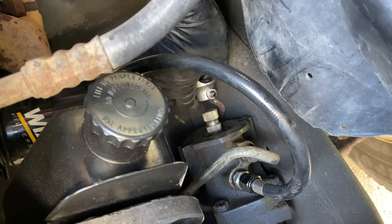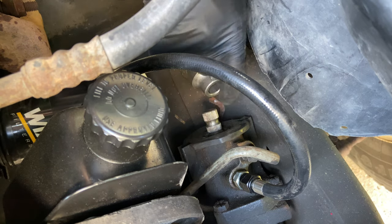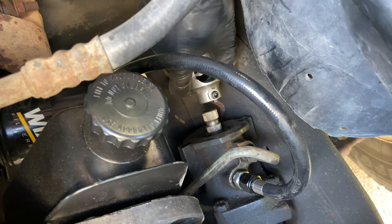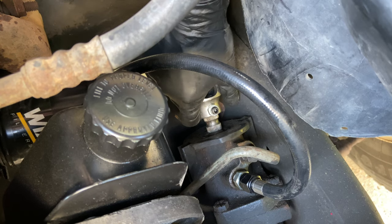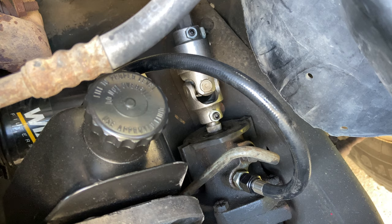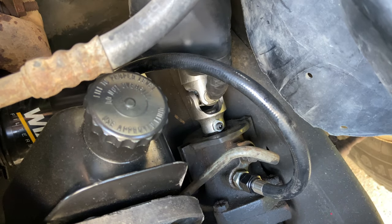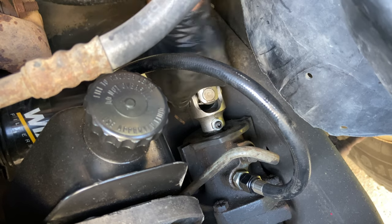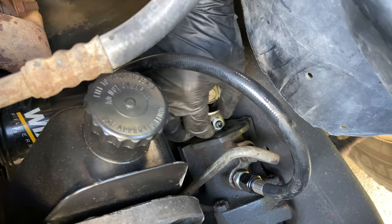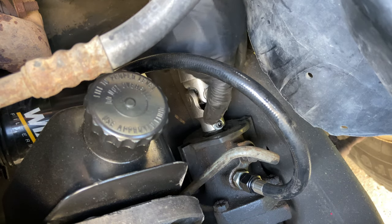Back in the engine bay — here's the other end of the steering shaft. There are splines on the steering gearbox and splines on the end of the shaft, so you really can't get them mixed up. Pull your shaft forward, line up the splines, and wiggle it on. Check where the steering wheel is. You don't want the splines sticking too far past — find that even middle spot. Then tighten up the set screw and bolt and you're good to go.